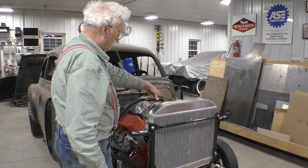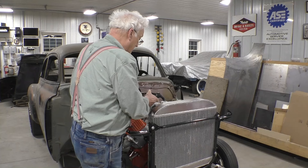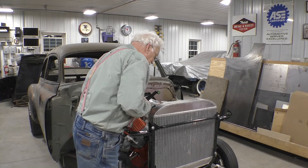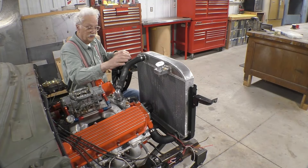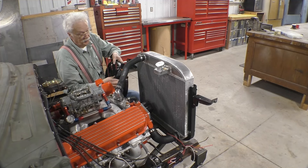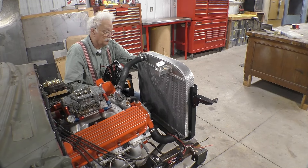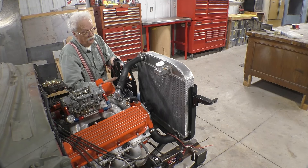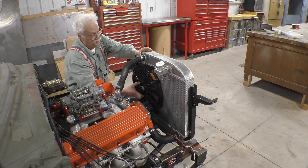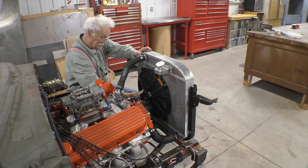This one is going to take forever to fill. The radiator and hoses aren't leaking. Now is the time to start thinking about our fan. In the old version there was a fan on the front and it was a pusher — a lot of people didn't like that. This is a puller and it's going to mount on the back side of the radiator, but unfortunately I can't mount it in the center because there's no clearance between the motor's electric water pump and the fan.